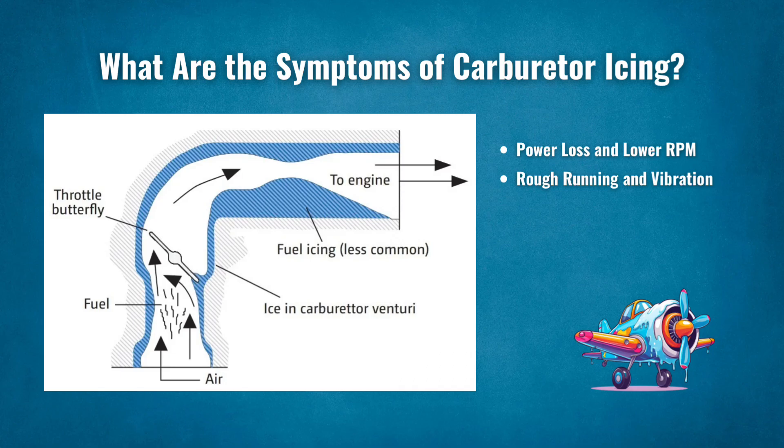A carburetor is a calibrated component designed to deliver precise ratios of fuel and air to the engine cylinders. If there is a blockage or restriction, this ratio is thrown out of kilter. The end result could be an engine running too rich or lean, leading to rough running or vibration. A third sign is lower EGT — less air and fuel burned means a lower temperature at the exhaust. If the EGT is particularly low, carburetor icing is a likely culprit. A fourth sign is a stuck throttle. If the ice builds up significantly, it can freeze the throttle in place. Aircraft are particularly prone to this when the throttle has been left in the same position for an extended period, for example during the cruise phase of the flight or a long descent.